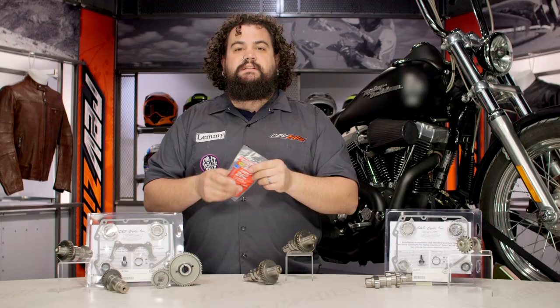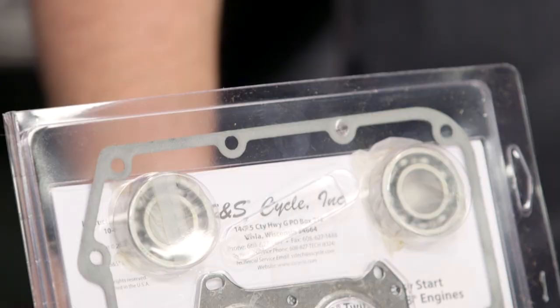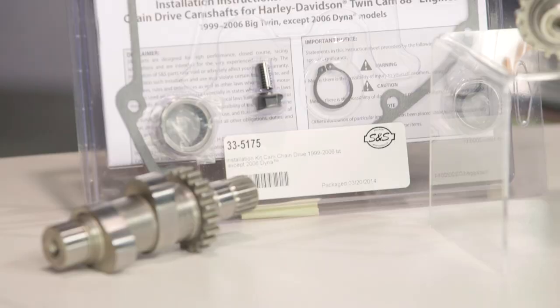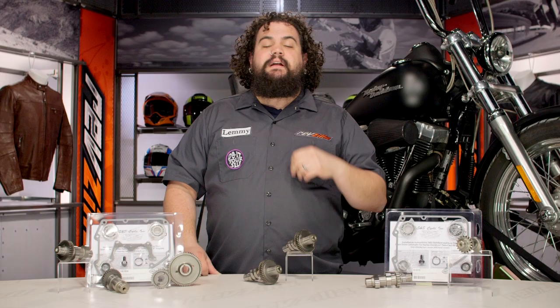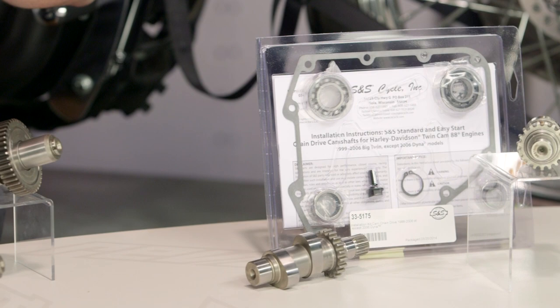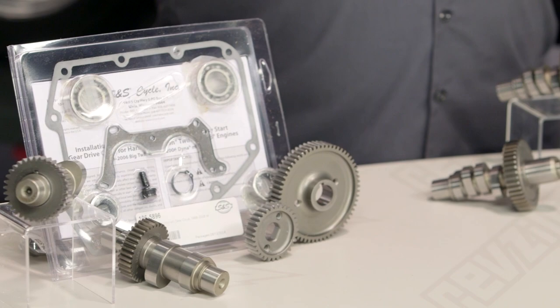Moving on to installation itself — I'm not going to lie to you, installing a camshaft is a little bit difficult, but it's not impossible. Home mechanics have been doing this for years. It's probably a little bit easier on a single cam motor than a twin cam, but it's not impossible either way. A service manual is an absolute must — you have to have one to do this job correctly. You're also probably going to want precision measuring instruments; a set of feeler gauges is a bare minimum. You don't want to eyeball internal motor components. If you use lots of assembly lube, follow your manual carefully, and follow the S&S directions, this really is a rewarding project you can get done in an afternoon.